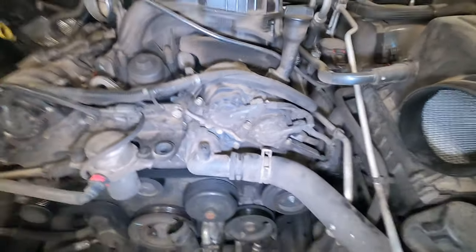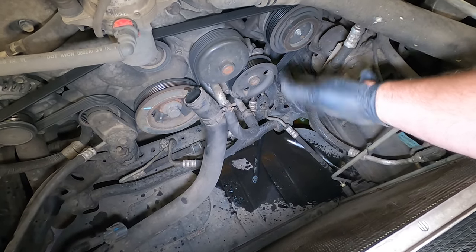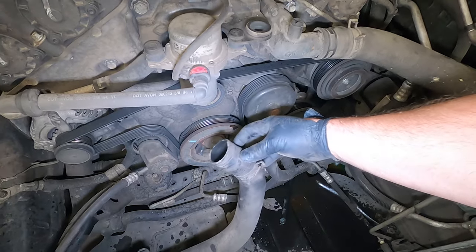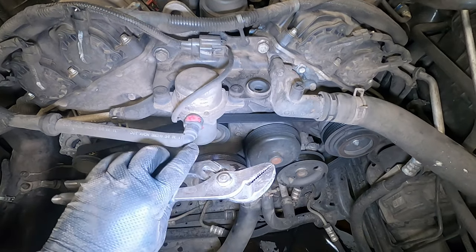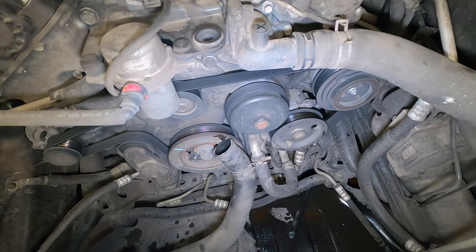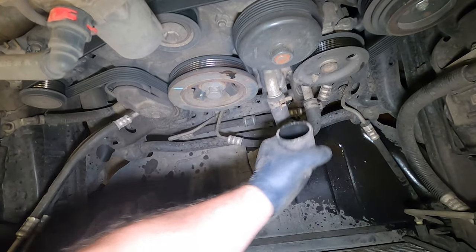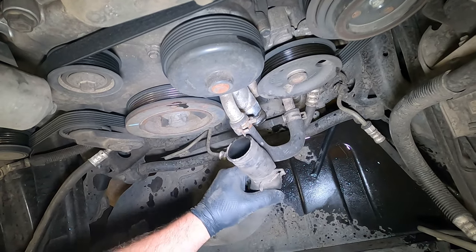Okay, now what you can do is, since I had it drained, the hose popped off, but I just put my bucket underneath that shield and it just drained right in there. So now I just need to have these radiator hoses removed. I already got the bottom one removed. I used this tool right here, some channel locks, just bent on each side, extended it, pressed them, and just lowered the clamp down, and then with some grit in your hand, it made a twisting turning option for it to unseal from the water pump outlet here, and then it came off.